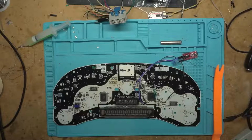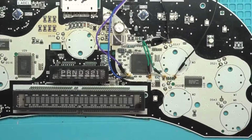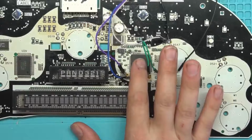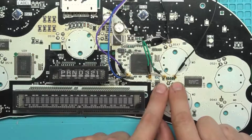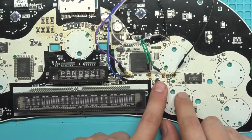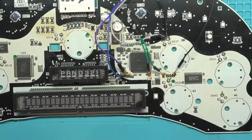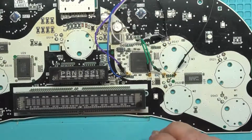Okay, I'll zoom this in and explain it now. We have two pins. If I remember them off the top of my head, it's like 80 and 89, or 86 and 89. I can't remember exactly what pins they are, but they're these two right here. Are there 5-volt lines that go to it? You need to pull them down to ground to get into the BSL. It's like P0L4. Oh shoot, I gotta find my notes. I can't remember what the other pin name is either. But yeah, pull those two pins down low, and that puts it into reset.